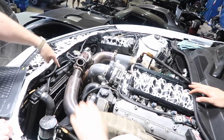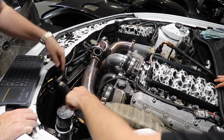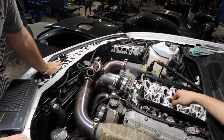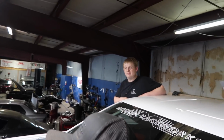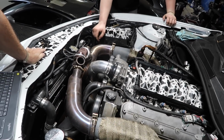So here's the difference. The wastegates before sat right here, direct downstream, so they would dump. I mean, it's harder for the air to get out now. The same pressure will make more boost with less dome pressure. Yeah. Which I don't care, because before this it's coming straight out right here. It's coming straight out. That's easy as hell.